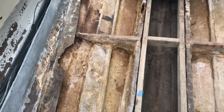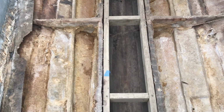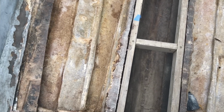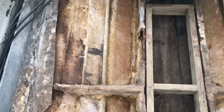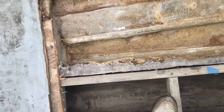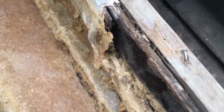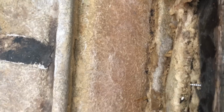I know you probably see some foam pieces in there, here and there. It just ain't coming up. So what I'm going to do is use a penetrating epoxy resin, which will penetrate that foam and basically turn it into solid rock, which will actually help with the structure. So that's fine. I had one spot that rotted. Everything else is legit. I'm going to do the same thing, penetrate the epoxy with a piece of wood on the outside of here, and I'm going to peanut butter the inside, and that'll be strong, and I'll leave that outside piece of wood there for support.